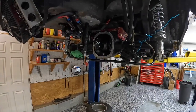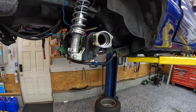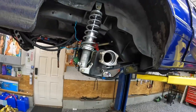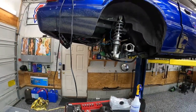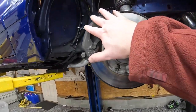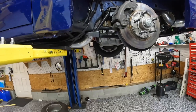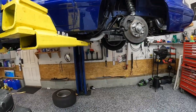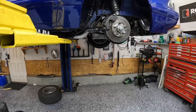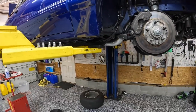I'm waiting on the parts right now — they should ship this week and hopefully be here maybe next week. Then the following weekend I'm thinking we can do the install. That's kind of why the car is all torn apart right now. I've got the axles out and I still need to pull the carrier. Back up front, all of this has to come apart — we're gonna pull it all off and we have to modify the spindle a little bit for the Strange stuff. Once we get that all in place with the manual Strange master cylinder, I should have pretty good brakes without the booster.